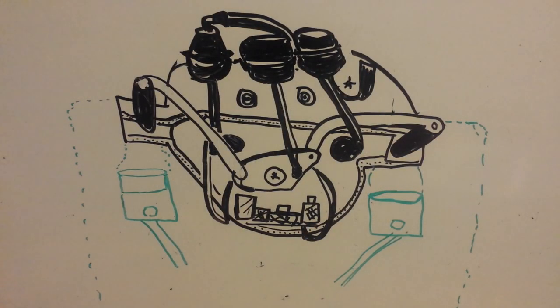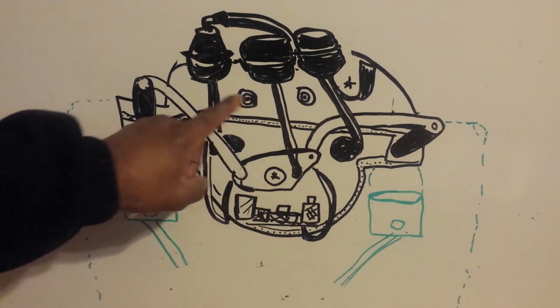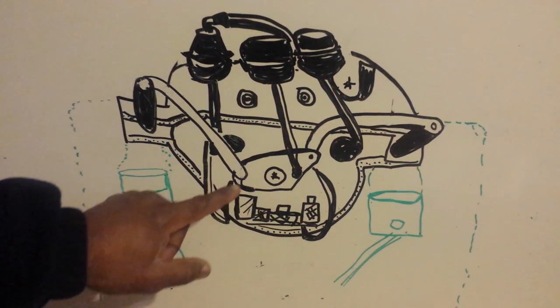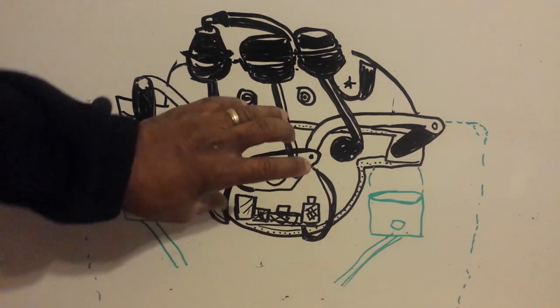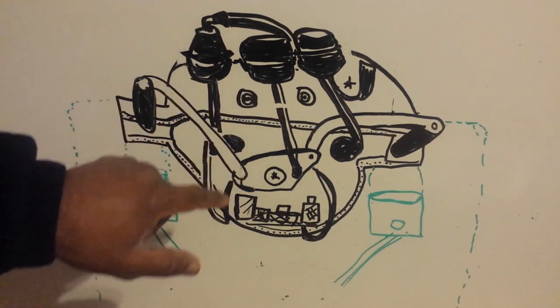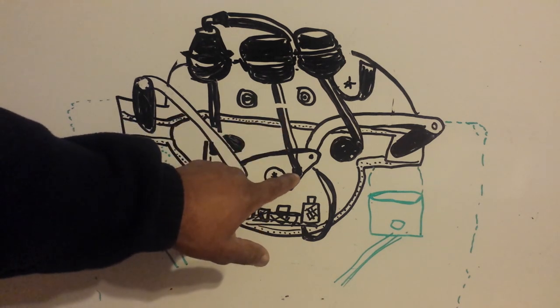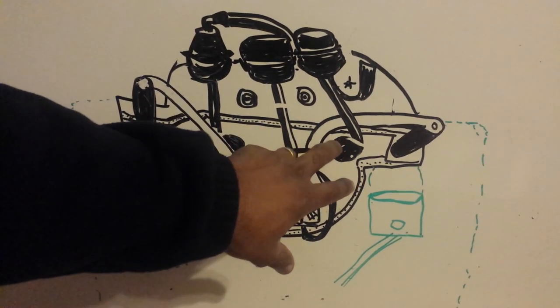So as I was saying earlier, some of the components that go bad on these air intake manifolds for Mercedes are the plastic pieces, these pieces here, these rods are made out of plastic, and when the internal flaps get corroded with gunk, those flaps get harder and harder to open and close, and the weakest plastic piece will break. Usually I've seen breakage right in the rod itself or the connection piece. Usually at the connection piece they'll break,